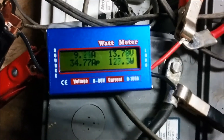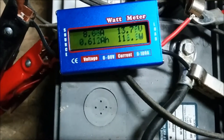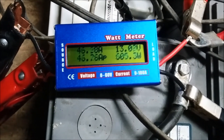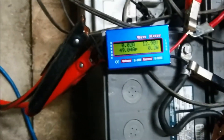When I flick this switch, it's going to put a 100-amp load on the battery bank and you should be able to watch the amps and watts go up here, and you should hear the alternator bog down. At that point the alternator bogs down so much — I missed it, I was going to disconnect it. It looks like 600 watts is the max I can get out of that generator.